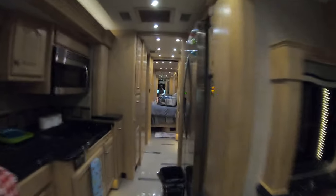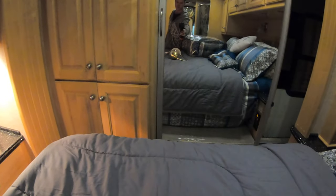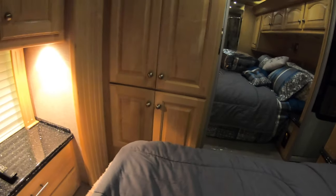This rear passenger room is a bit more of a challenge because the output module I used is in that closet. The wires come across behind the washer/dryer, across the top of this slide room, and then through the track system that the 110 and 12-volt go through. Then I came down in this corner after pulling the safe that was here, ran through there, and came down to the very bottom inside this cabinet — that's where I come through the floor and make my connections for those lights.